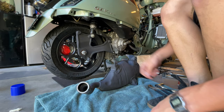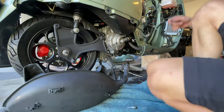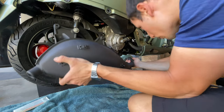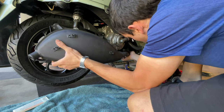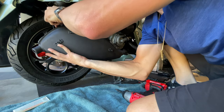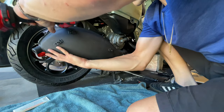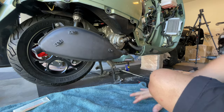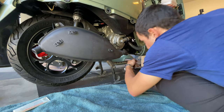Make sure you check down the description below — I have all those items available on the website. So you just want to get that spring clamp, put it a little bit more down. Go ahead and slide that in, get the screw started. Hold the exhaust so you're putting all the pressure into your bolts. Now you just want to go ahead and tie your clamp down.